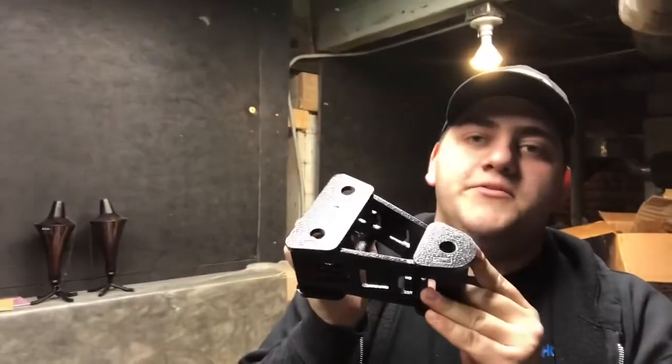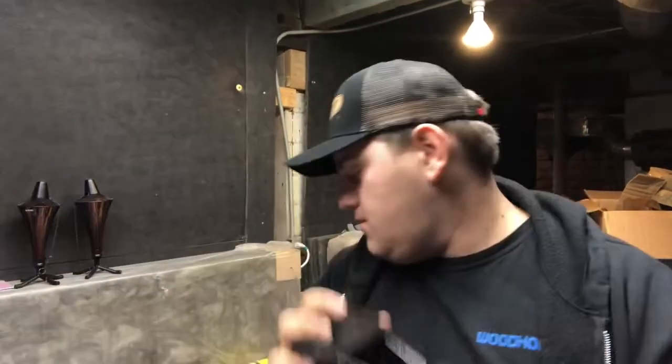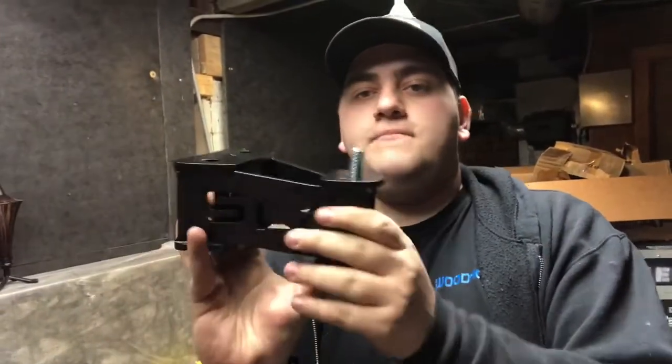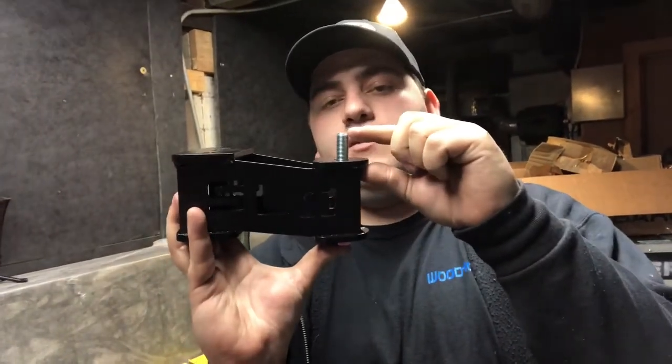So we just ran into an unfortunate event. Extremely unfortunate. While Liam was trying to take off the trailing arm bracket, the bolt came loose, but the nut inside the unibody broke off. To explain that a little better, we have the bracket here that we're trying to install. A bolt goes through this and into a threaded insert in the body, exactly like that. So you have that much thread into a welded nut in the body.